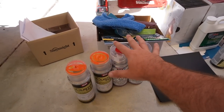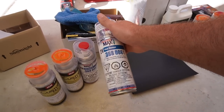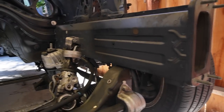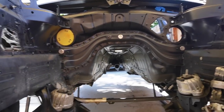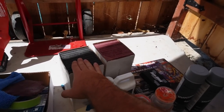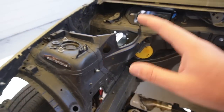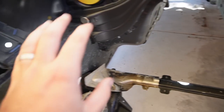This setup was $100 just for four cans. The separate clear coat is a bit cheaper and I heard it's the good clear coat with hardener in the can as well. This is pretty much the best setup you can get with spray cans. We got scuff pads because the engine bay is already painted and we don't need primer. We'll use the red scuff pads, then the black scuff pads, then 400-grit sandpaper, then 600-grit, and that should get it fully smoothed down. Prep is the primary thing - so let's degrease the entire engine bay.